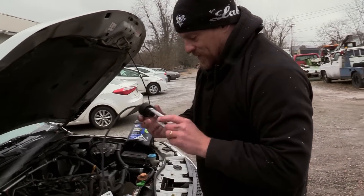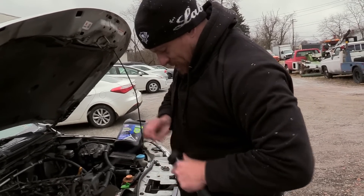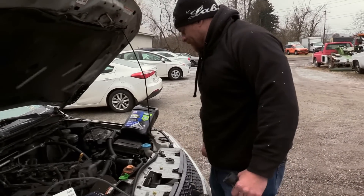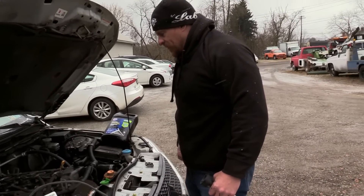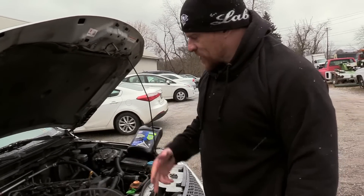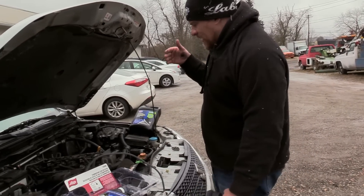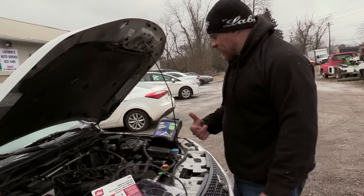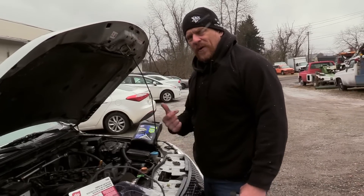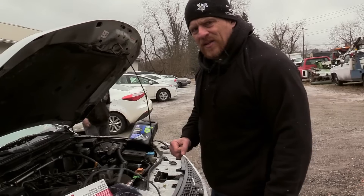A little different than what I'm used to, for sure. But that's kind of cool. I had Pete fill this up, but the problem is we went a little bit too full with it. Two things: I want to make sure the cooling fan comes on. Given the history — the radiator went bad, leaked everywhere, the car overheated — I'm not certain why the water pump was replaced, but it got a water pump, thermostat, and rad, and it is overheating.